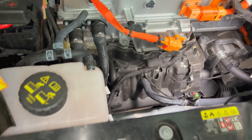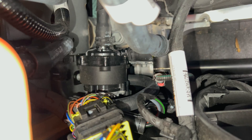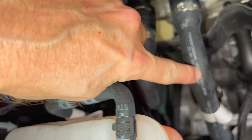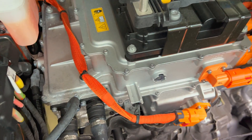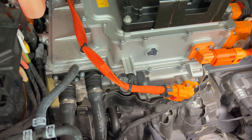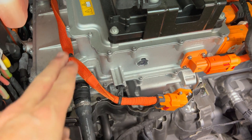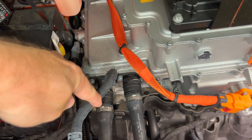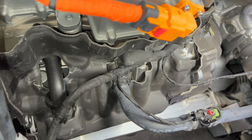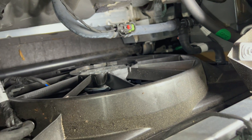Taking a closer look inside, the front motor pump is the easiest to see. The outflow goes through a pipe that leads into the inverter and drivetrain modules, cooling the inverter and also the motor. There's an outlet that comes out and goes down into the motor, and eventually the coolant exits the motor and is routed into the heat exchanger or radiator area up front.